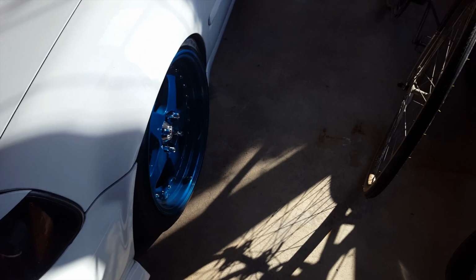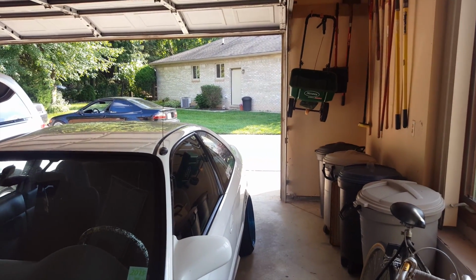I just put Integra brakes on it that I got off a junkyard car, and they're not working right. They're rusty as hell, and I just threw them on, whatever. I'm gonna get new rotors and pads eventually, but right now it's just not wearing right, just because it was so rusty. So if you take a look there, you can see it's not making really any contact there.